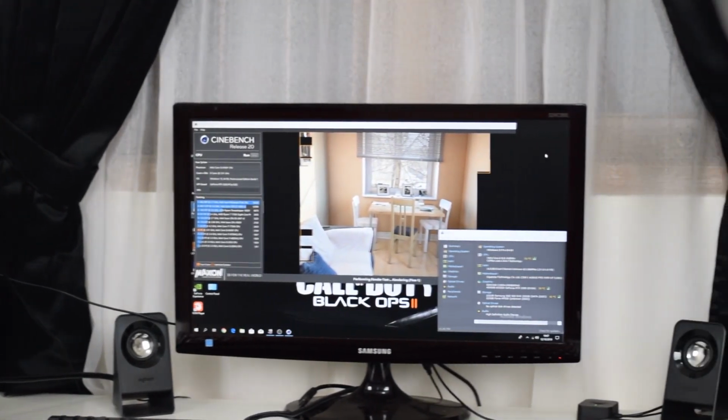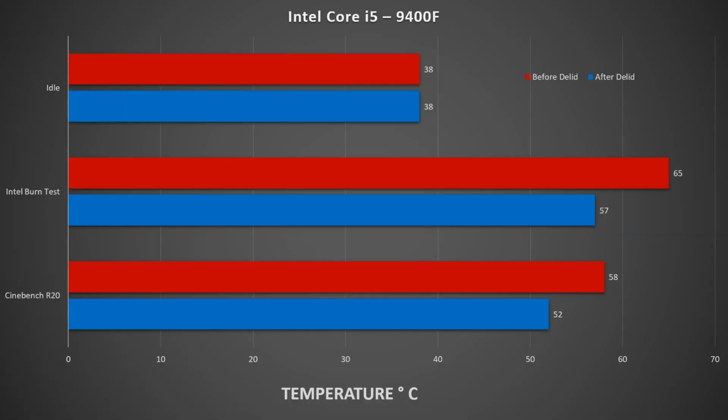So here is the short summary. As you can see on the chart, in idle condition, there is no temperature difference before and after the delid. When we do the test with Intel Burn Test, there is an 8 degrees Celsius temperature difference. And when we test it with Cinebench R20, there is a 6 degrees Celsius temperature difference between after and before the delid. Thanks for watching, and I'll see you next time.